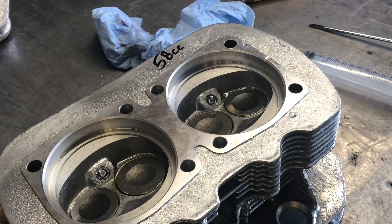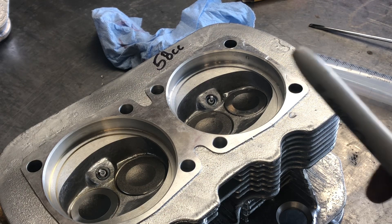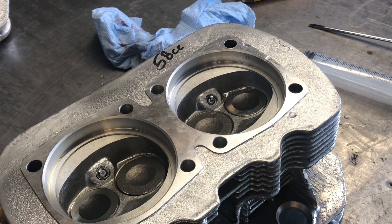You need this measurement along with your deck height measurement in order to get a compression ratio. Depending on what cam you're running will determine what compression ratio they recommend. This engine we're running an Engle W100 on a 1641cc with the big valve heads. This is not my setup - it's what the customer wants. The W100 cam actually calls for around 7.5 to 8.25:1 compression. Hopefully the deck height will be okay - 58cc chambers should put us in the ballpark, though I have a feeling we'll be on the lower side. That'll be the next video.